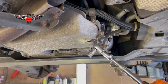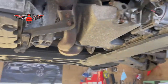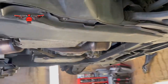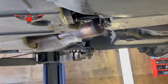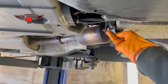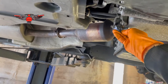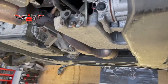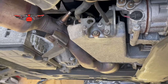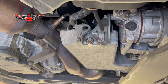If you see any oil dripping you can tighten it a little bit more. Now we just want to wipe the area clean there - that way next time, next year when you do the service, if there is any oil there you'll know. With this nice and clean, I'm going to lower the car and then we can top up some oil and fit our new filter.